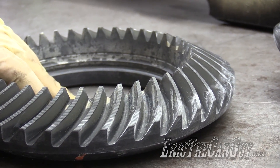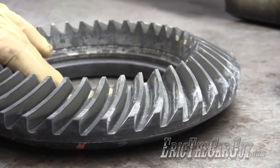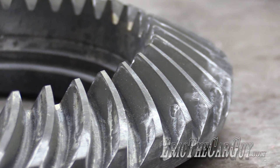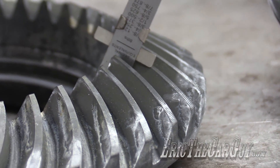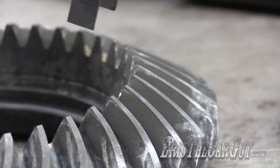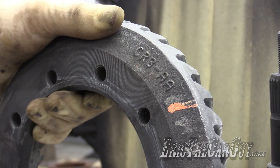Here's something else that's really important when you go to set up your gears in your differential. There are two different manufacturing processes used to make gears: face hobbed and face milled. Most gear sets are face hobbed. With a face hobbed gear set, it's the same depth from the toe to the heel — all the way down into the valley, it's the same depth. On a face milled set, there's a taper, so one side will be higher than the other. That's very important when you're trying to set up your gear tooth pattern and backlash. Face hobbed gears are cast, so you'll see some casting on the inside.